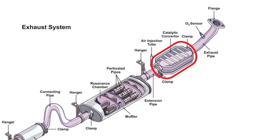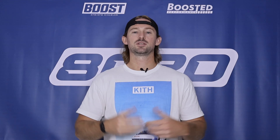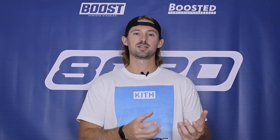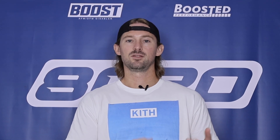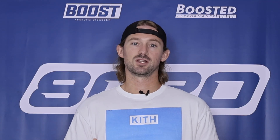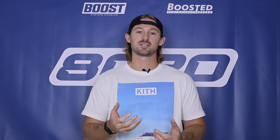This allows us to gauge how efficient the catalytic converter is and how well the engine is reducing emissions. When the downstream secondary sensor reports an extremely low voltage, it means the sensor is reading a completely unrealistic amount of oxygen in the exhaust gas — something like 90-plus percent oxygen — which is just unrealistic even after passing through the catalytic converter.